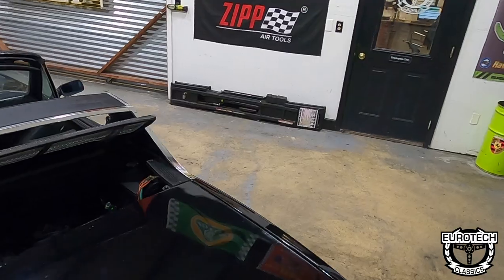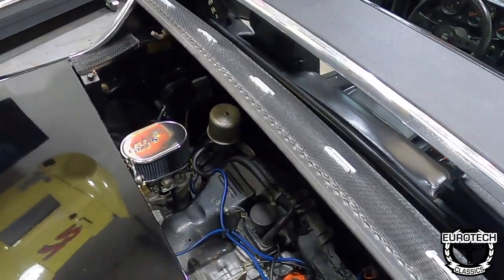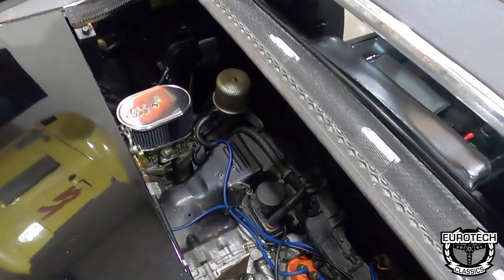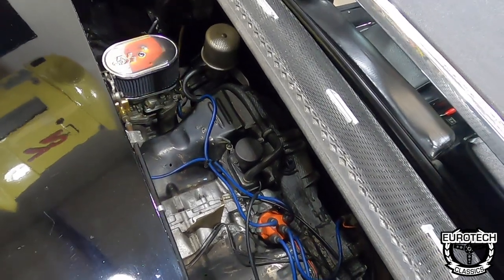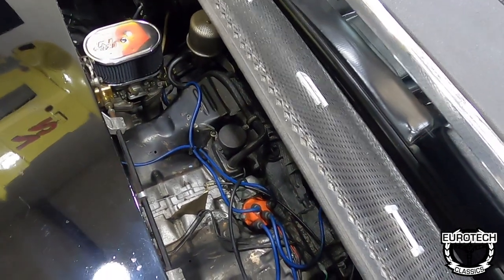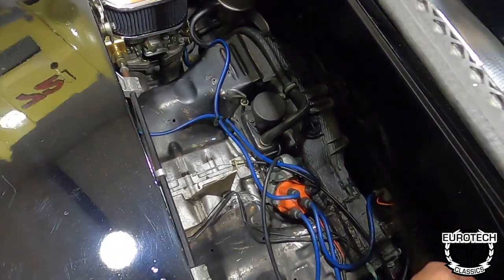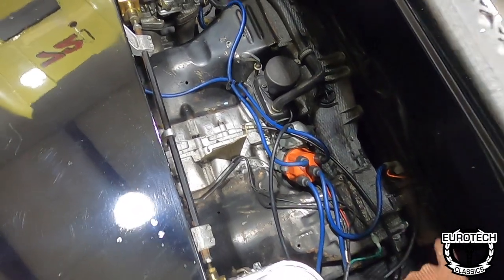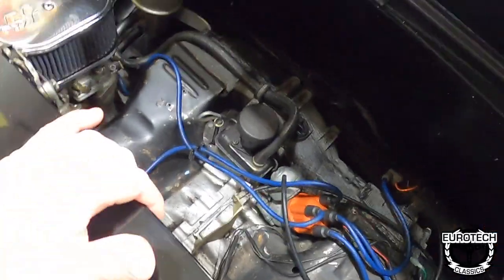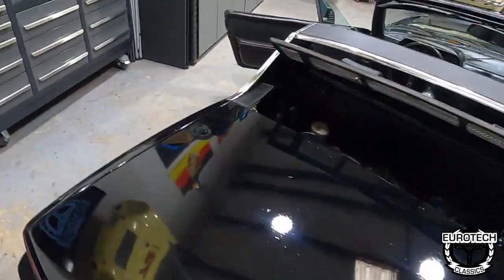I have the battery disconnected right here for storage. This vehicle has been sold and is waiting for pickup. Now, when people say the 914 hellhole, what they're talking about is on the original batteries in the 70s — when they're not sealed, they'll actually leak battery acid down below the battery tray onto that suspension joint. You'll see a lot of rust there, a lot of bad repairs. This one is dry — it's a Southern California car, very dry. That's why I bought this car.